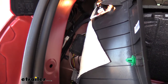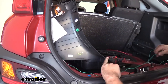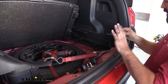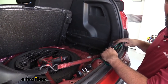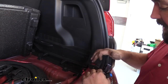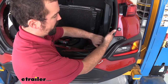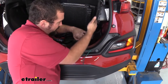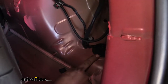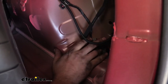While we're up here, we're also going to take our green wire and route it in where the scuff panel was — it's going to hide under that scuff panel when we're done installing. We're going to repeat the same process and get to our taillight plug up there. Same as we did on the other side, we have our phillips screws — pop this back and get to that plug. With our panel popped from the clips, we can reveal a grommet similar to the one on the driver's side, so we'll pop this grommet out and feed our green wires through here.